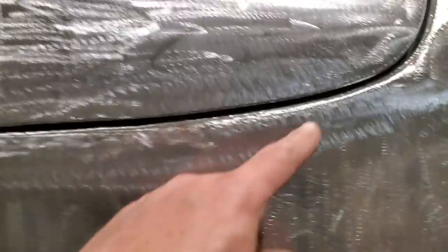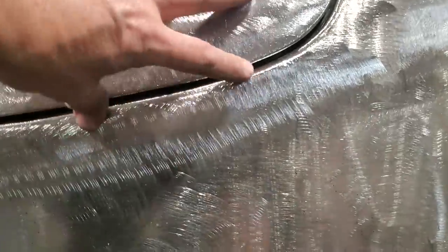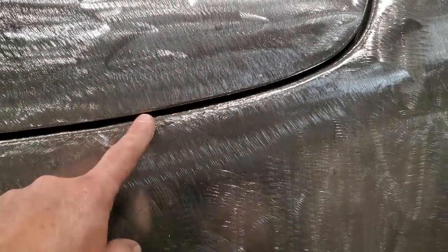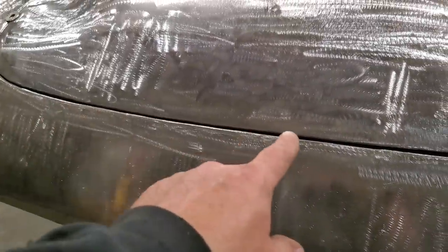Much the same process. When you cut too much of this, it's going to want to move. So if you took four or five inches at a time, cut it, adjusted it, and just don't weld it right to the end, then turn around and work from there and work your way across. That's what I've got to do right here now, so I'll do the same process here.